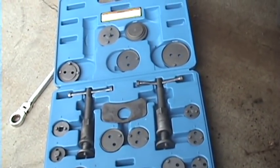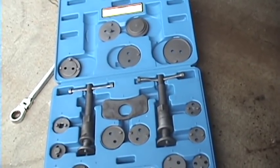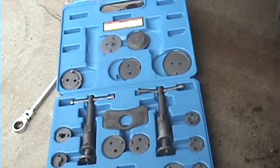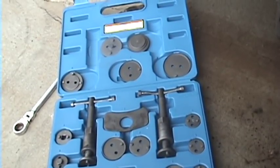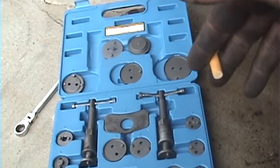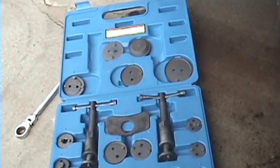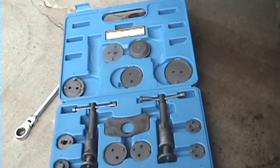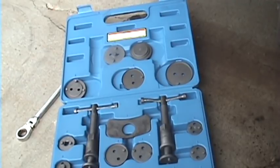You can also use the Cube — I mentioned that in my other video, I'll probably put up a link in the description. They work pretty well on most imports, no problem, except for Volkswagen where I had to modify them a little, and on Fords they'll slip off really easily. One of these sets, a Cube, or even needle nose pliers if your calipers aren't seized up — but it's best to use the proper tool for the job. At 40 bucks, it saves a lot of time and aggravation.